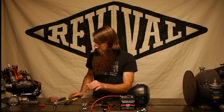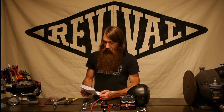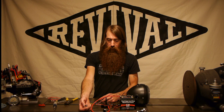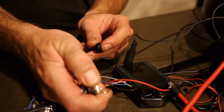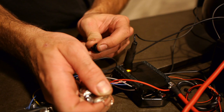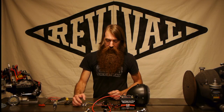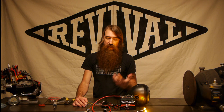We can also change the turn signal flashers — that's in menu option 7. We can switch to M-wave, which is a smooth fade in and fade out, versus the harsh on/off of a typical turn signal flasher. As we turn the system on and while the lights are racing around, push the configuration button, move down to menu option 7, and switch to M-wave. Now back to normal operation — you can see how it fades in, fades out. You can go back into the configuration and change that back if you don't like it.